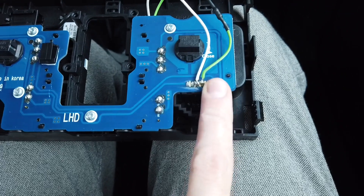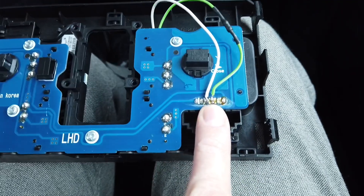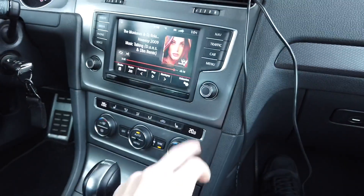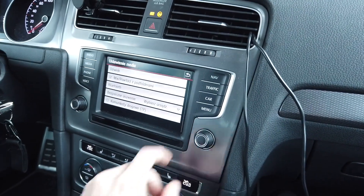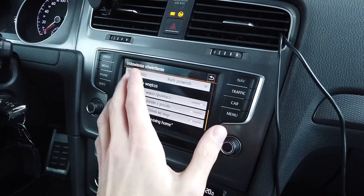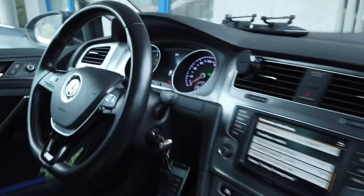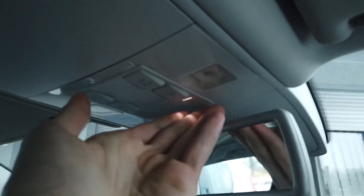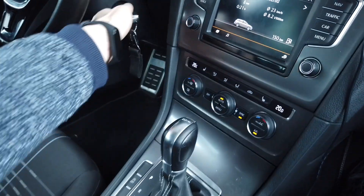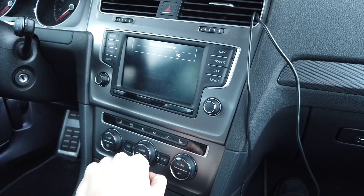The reason why I soldered to pin three and not pin one — pin one is 12V, available as soon as you turn the ignition on or unlock your car — is that pin three is terminal 58, which is the instrument cluster background illumination. This is the illumination for your buttons, and you can adjust this brightness from the menu under 'Light' and scroll down to instruments backlight. In US spec cars there's an adjustment wheel, but on this EU spec car it's in the menu. Using the 7.5kΩ resistor, you can adjust the brightness from the slider.